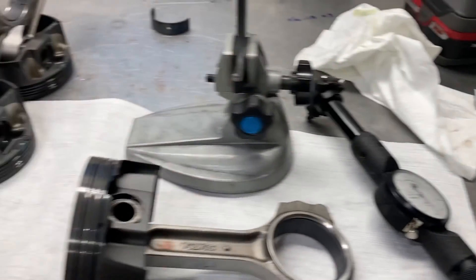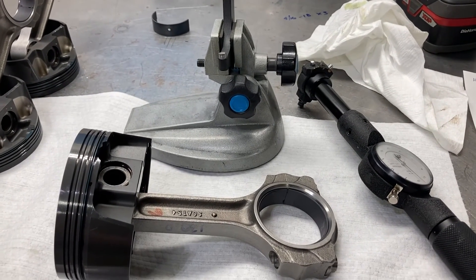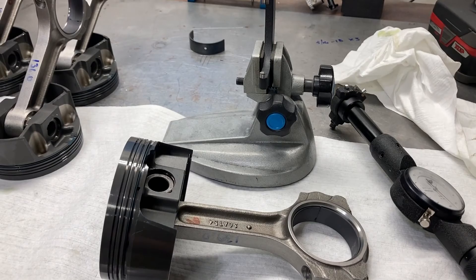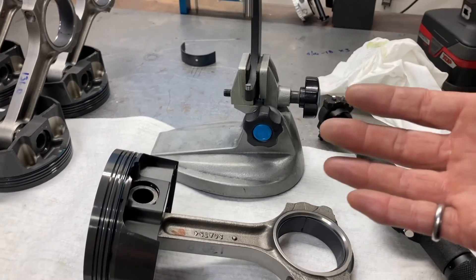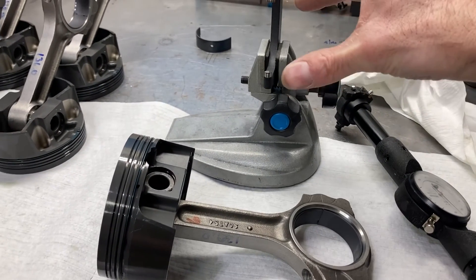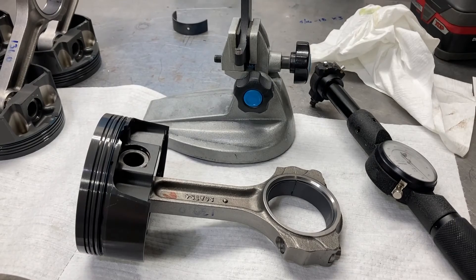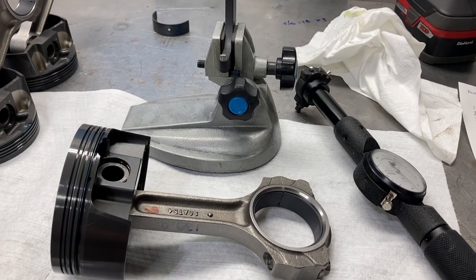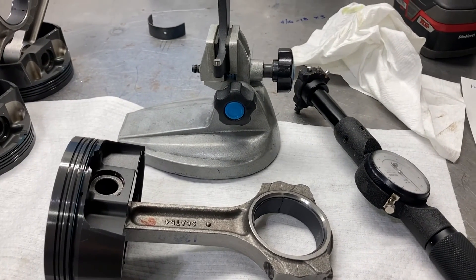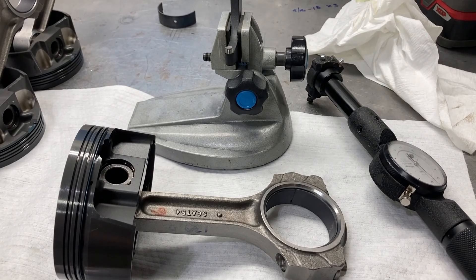So that's the gist of it. Now when you hear someone say they're going to check their bearing clearances, you know how that process is done. It's the same procedure for main bearings, and the same if you want to check your cam bearing clearances, which I do on some engines. Measure the outside, zero your bore mic to that, then measure the difference for your clearance. Thanks for watching — hope to have more videos up on different engine building procedures along with engine builds and dyno videos to help you guys out.